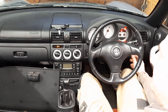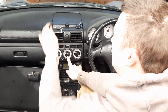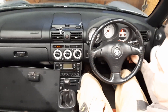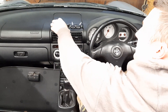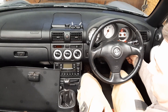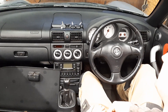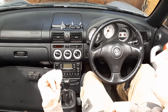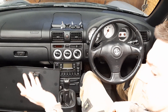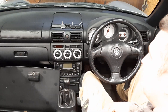If we turn the ignition on, the light's off. That key stops the car and the immobiliser light comes back on to say we're immobilised. And we do it again — that key starts the car. And that one. So there we go — we've got three MR2 Spyder keys, MR2 Roadster keys, and they're now starting up the 2ZZ ECU. You don't need a JDM ECU, you don't need some fudgery. All you need to do is virginise the ECU with the file on the EEPROM, and then it will just start the car. Enjoy.